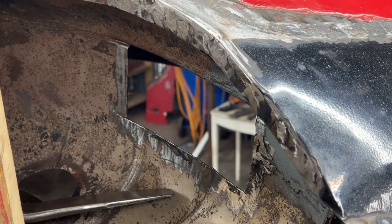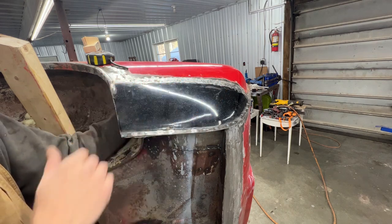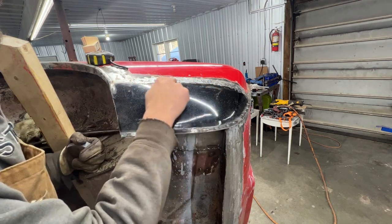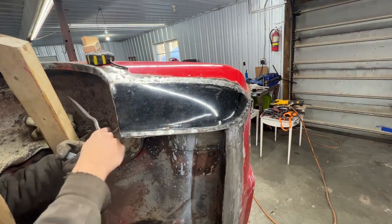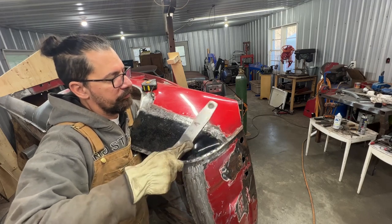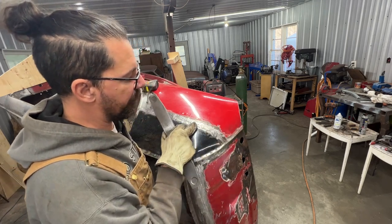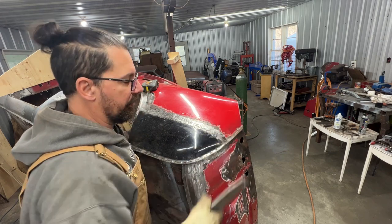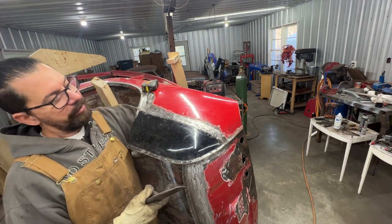Now we can make this patchwork here, but before that I'm gonna use the opportunity that I have a hole here. I can actually reach inside — even though I have this inner fender, there are holes in it, and I can put a dolly inside and fix this area a little bit. It's still low in some areas, so let me see if I can planish it a little bit with the slapper. As it comes out, now I have to grind the weld because the weld becomes too high. That's gonna allow me to bring the metal even higher — wow, that's nice. So there was a use of this hole anyways.